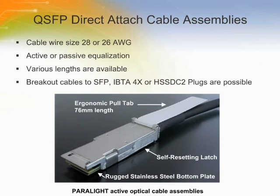The QSFP direct attached copper cable assembly is a low cost alternative for short reach 4X applications. The design allows for serial data transmission up to the QDR rate of 10 gigabits per lane for an aggregate of 40 gigabits per second. QSFP cable assemblies are hot swappable and the programmed EEPROM signature enables the host to differentiate between copper cable assemblies and a fiber optic module. The mechanical design of the braid crimp ensures that EMI radiation is suppressed, and the copper cable acts as a natural heat sink. Low power consumption makes the passive copper cable assembly an economic solution for within-rack or rack-to-rack applications.